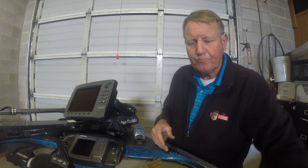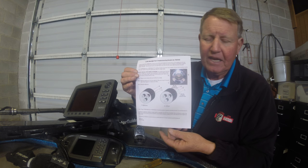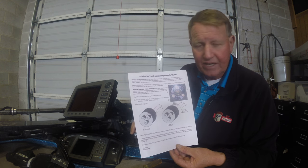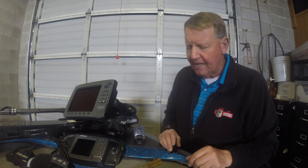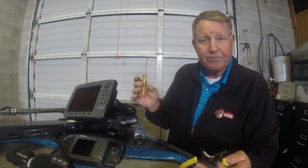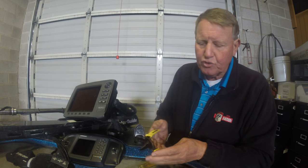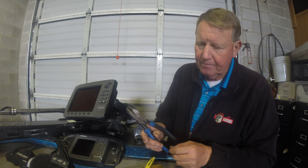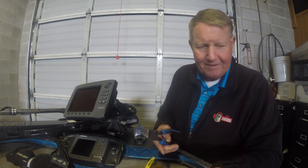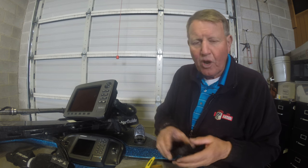Yolotech has produced a neat little instruction sheet — you can get it directly from them. If you have to rewire your front navigation port, these are the steps you'll take. The tools you need are just a standard Phillips screwdriver, something to cut your wires with, a heavy electrical crimping tool to smash the wire connectors on, a couple of wire connectors, and some electrical tape. That's really all you need for this project.